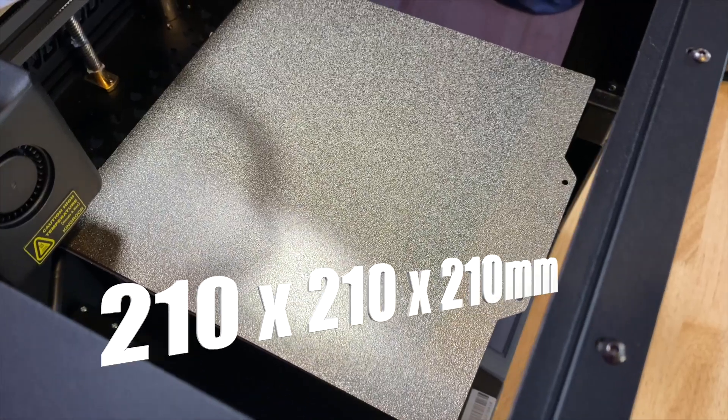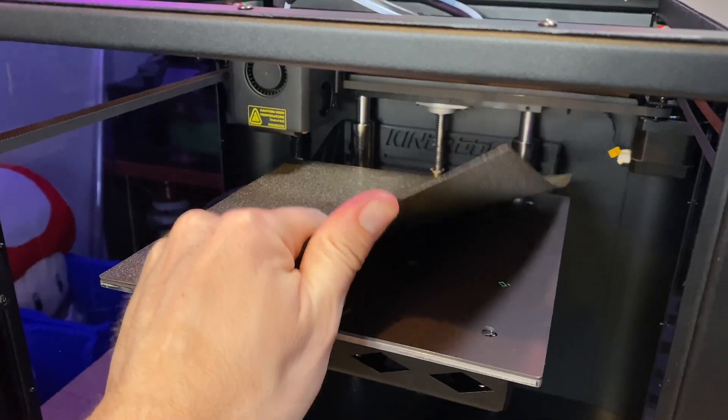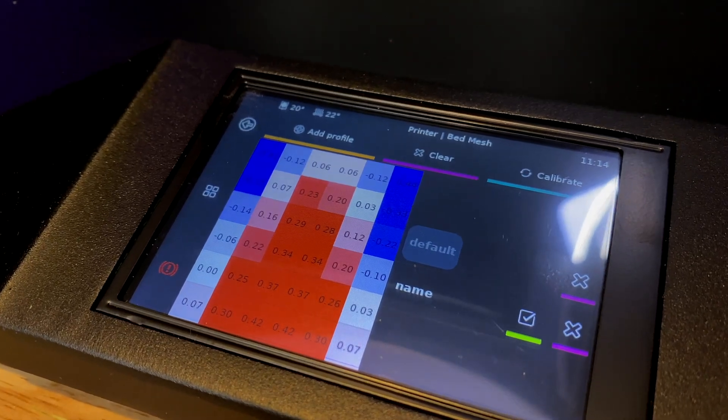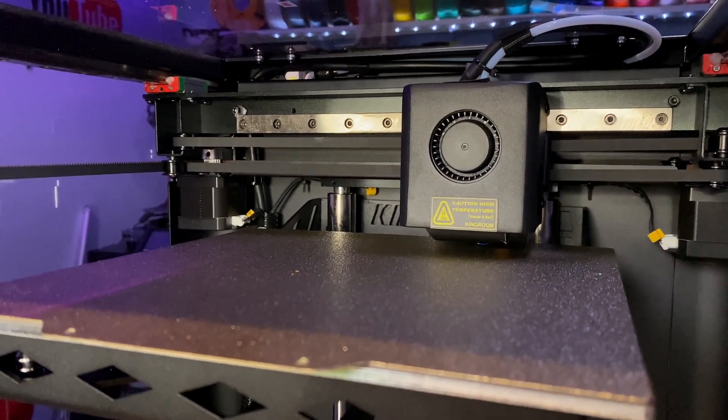The build plate is relatively small, but that goes along with the territory of having a small footprint. It's 210mm cubed. To give you a sense of scale, a Prusa Mini is 180mm cubed, so the build volume is just a little bit larger in every direction. The majority of people 3D printing can get away with 180mm build volume, so don't let that scare you off. The build plate reaches 100°C and comes with a flexible PEI removable sheet. Auto bed leveling is done with a mesh-type system — it goes across the build plate, makes those calculations, and gives you a nice, smooth, even first layer.